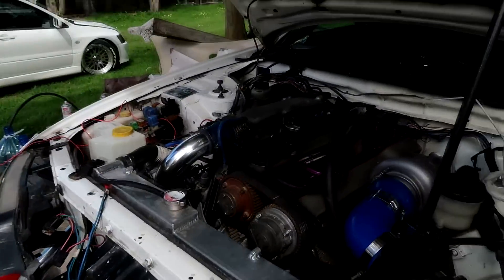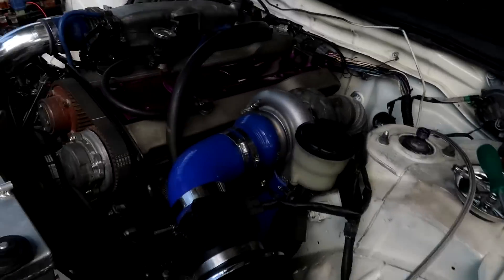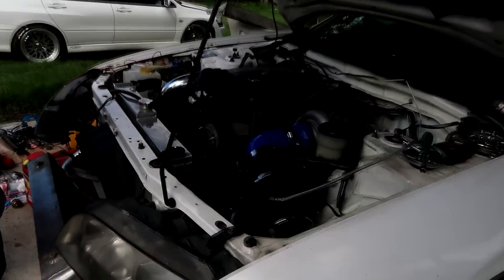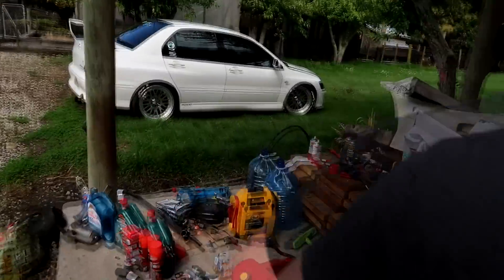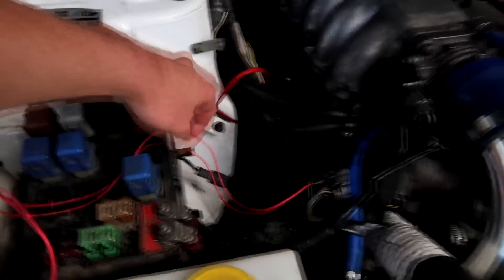The engine's been freshly rebuilt, so obviously we want to drop the oil, change that, run it up properly, run it in and then change the oil again so we know it's all fresh. New filters, we've got wiring, relays and all sorts to make switches for the fuel pump and the injector, because we're just going to run a dedicated feed to the harness.